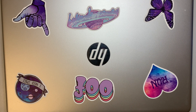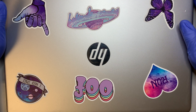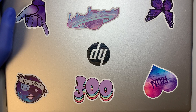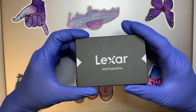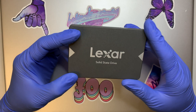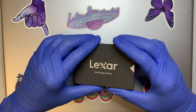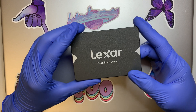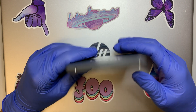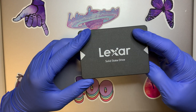Hi, welcome and I hope you are doing well. In this video I will be doing a teardown on an HP laptop and at the same time I will be changing the hard drive to an SSD drive. This is a brand new SSD drive. When I change the regular spinning hard drive to an SSD drive, the computer will not be able to start up and boot to Windows because the new hard drive does not have an operating system.